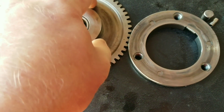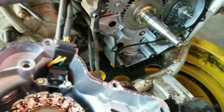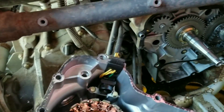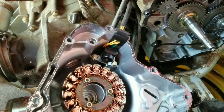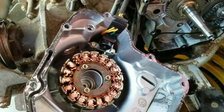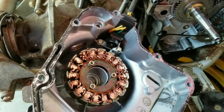The new one will drop down in here and I'll probably clean that out while we've got everything apart - all that material in the bottom. I won't go crazy with brake clean or carburetor cleaner on all those gears because I want them to have a little oil on them when this starts back up, but I'm going to clean out the bottom of these cases. We may do the stator next while we're waiting in the mail for that starter clutch, because I do have the stator. Then later in the video we'll actually finish putting that clutch back on.